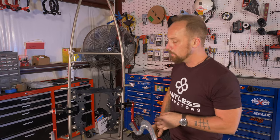There's about 2 centimeters right there. There's a way to tighten this shaft down correctly to make sure that everything's sitting flush and snug. Take your ball-ended Allen. You're going to bring one of these screws in until it's almost touching and kind of feel it. Now, take this shaft, jiggle it back and forth, and what you're doing is you're finding the bottom of this machine slot here. That way, if you have it cocked in there, potentially this may shift a little bit and then your screws could potentially loosen up. So rock it back and forth like that. And that'll get everything nice and seated.